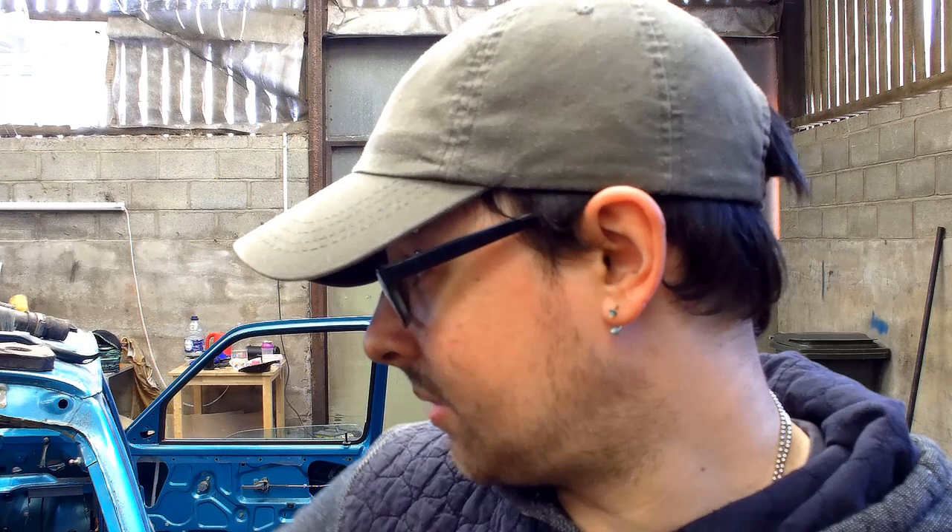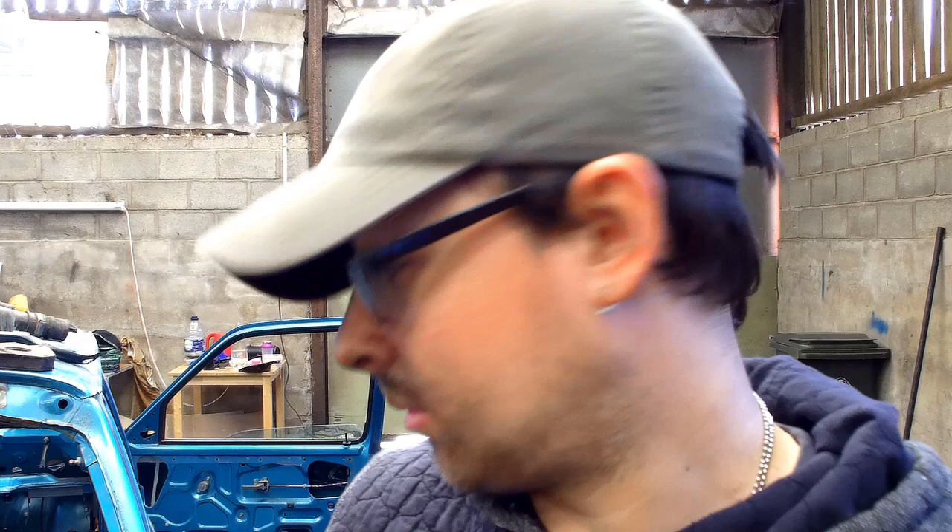So — one Rover 100 sat on MGF subframes, on MGTF coilovers. I'm dead happy with it. It's sitting a bit lower than I want, but it can be adjusted with buying some thicker rubber blocks. I've got plenty of thread on the nut, so if I need to I can just lift it up or put a washer in to push it up a bit more. But I'm quite happy with that. It is sitting a bit lopsided, but everything's in the right place — it's just the floor. There are a couple more braces I need to make, and I'm going to do the one for the top of the coilover bracket that sits to the wheel arch, so I know it's nice and strong and it can't push itself up. So we'll crack on with that.